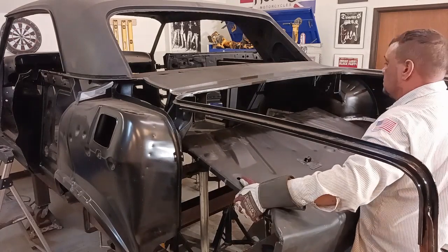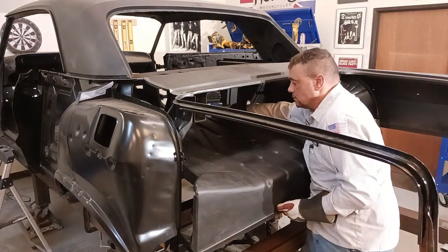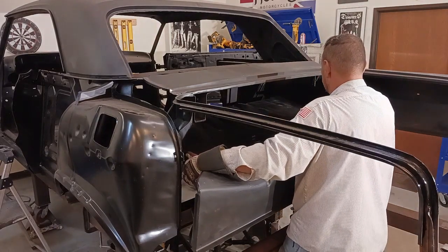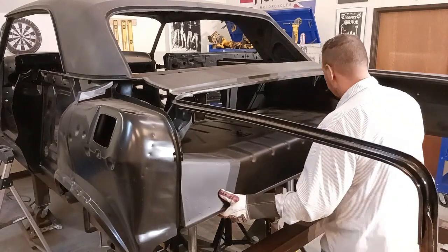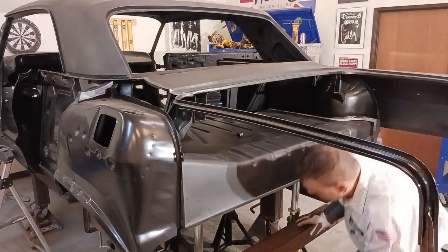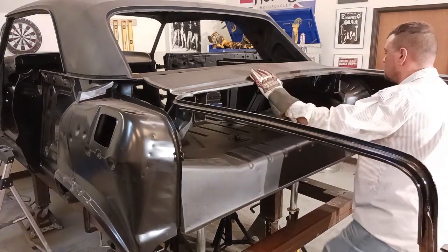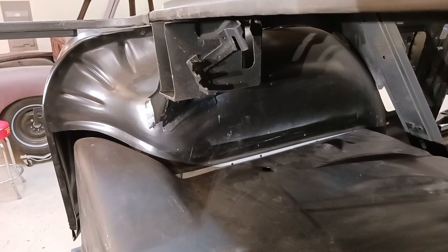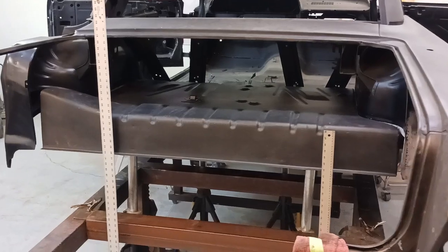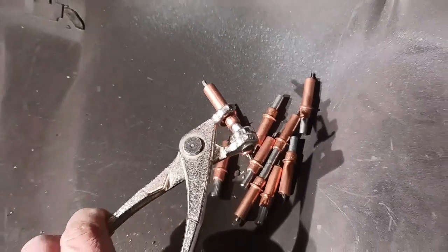And here we go with the actual upper deck installation, setting it into place. And yeah, it'll hang on everything that it can. And that's what the jacks are for, because we can raise and lower each side of that, front, back, side to side, super handy. And here's a shot of that. So I'm just turning that turnbuckle there. And what we want to do is go ahead and do a measurement just to make sure everything's square, level. If one side was down further than the other, well, we take a look at why.